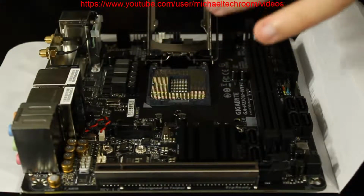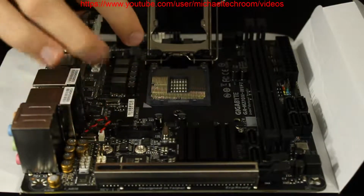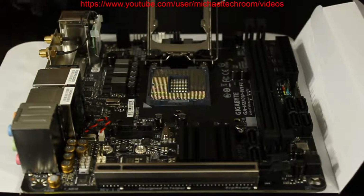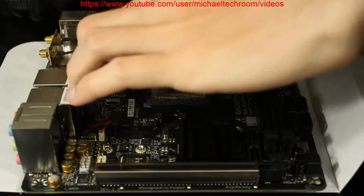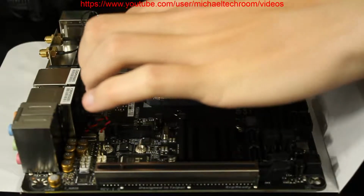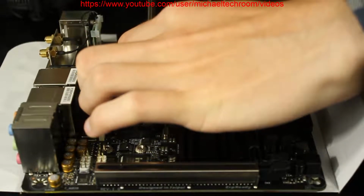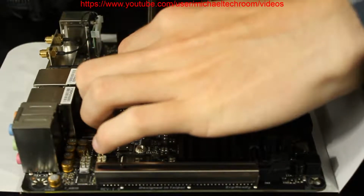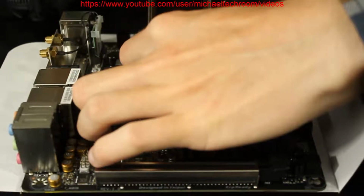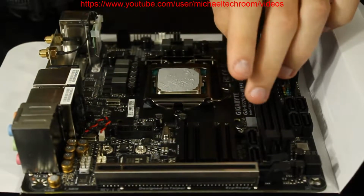So the standard way, if you don't know, is there's a triangle in the socket. There's 2 notches, and it looks like you can't see the 2 notches. Anyways, looking at the processor, yeah, that matches the gold triangle. Generally, when you face the right direction, you should see the notch, and you should set it in there very gently. Very gently, no force.